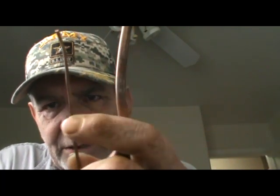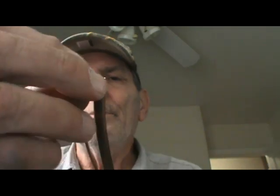Here's another thing. This is something that everybody is getting screwed up with in the HVAC schools and the HVAC instruction. Because there's not a metering device, expansion valve or otherwise, in our sealed system, this is the metering device. The diameter of that hole is such that when it goes into the bigger, this is only a quarter, but when it goes into the evaporator at 5/16 size, the high pressure now goes into that bigger tube and it becomes extremely lower in pressure because there's a lot more room in there than that tiny squeezed tube that it's coming out of. So it's not under pressure like it was when it gets into the evaporator.